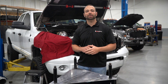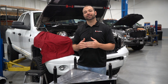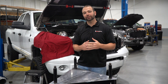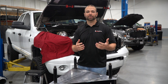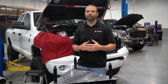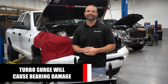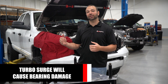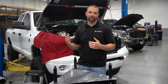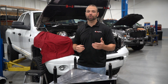The compound kit works by keeping both turbochargers in their maps — meaning no one turbocharger has to do all the work. Typically at low RPM and high load scenarios, that big wheel is on the surge line, meaning it's trying to compress more air at low air mass than is possible. Under really high load scenarios and high RPM, those smaller turbochargers are out of air — they just can't spin fast enough to compress the air mass at 3,000 to 3,500 RPM to make the power that you want to make.